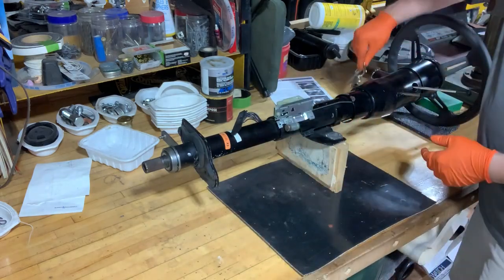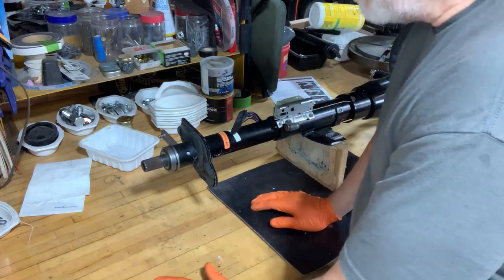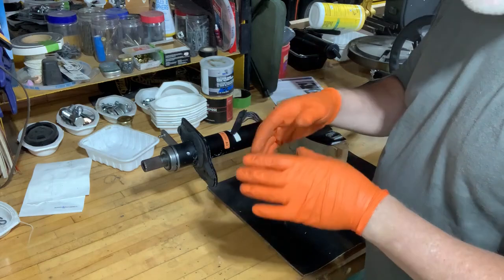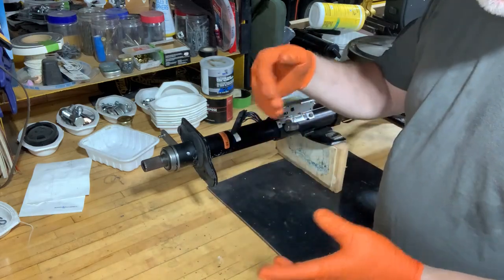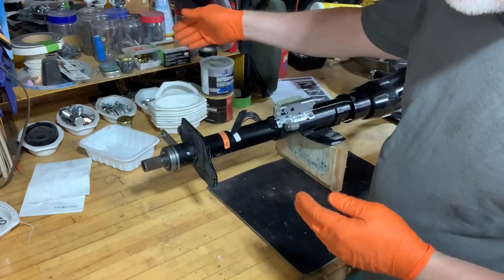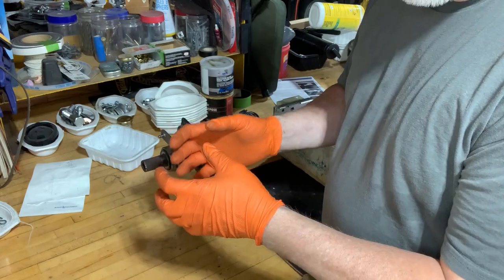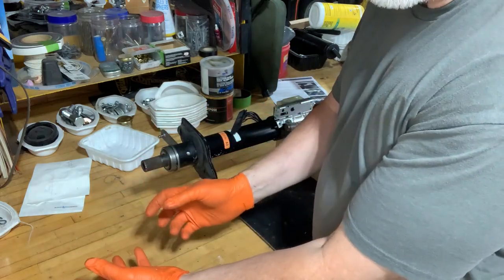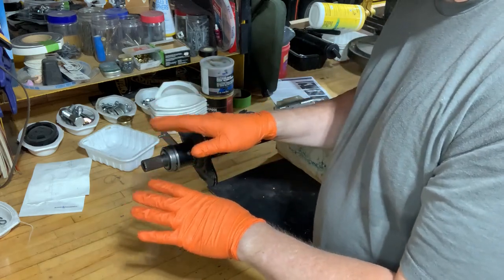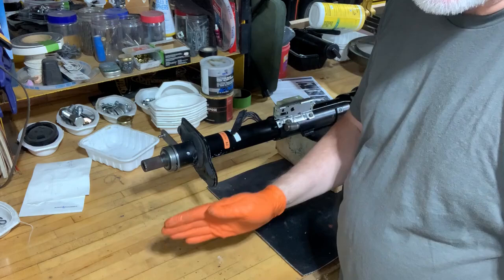The problem I'm having is I'm putting in a Borgeson, I think it's called, steering box instead of the original factory steering box in there, which had a separate set of valves and a slave cylinder that pushed and pulled the steering for the power steering. This new Borgeson steering box has the hydraulic motor built into the box, which makes everything very clean. There's two less hoses and there's less opportunities for leaks. My valve body had been leaking for years and it just drives me crazy. I can't stand a leaking car.